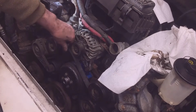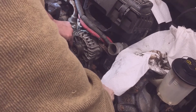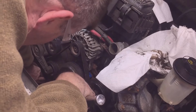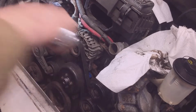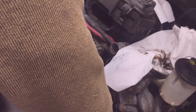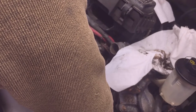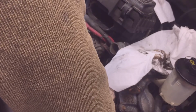And I'm going to do this one last, which is the favorite way I like doing it. Pull down on my wrench, slide it back on. There we go. Popped off in a few places. Here we go. And let's double check that. Yep, that's flush. Looks good. Pretty good. But just before we put that belt back on, as I'm pushing down, we should give all these pulleys a little wiggle. It hasn't been that long since I replaced them. We're in pretty good shape.